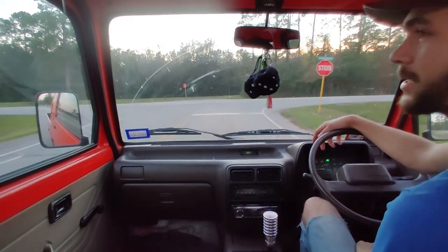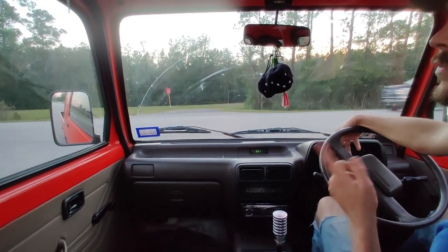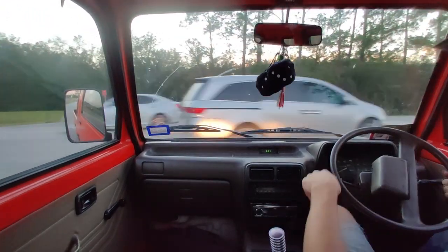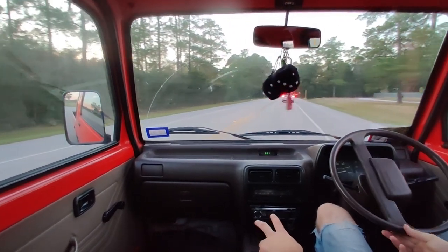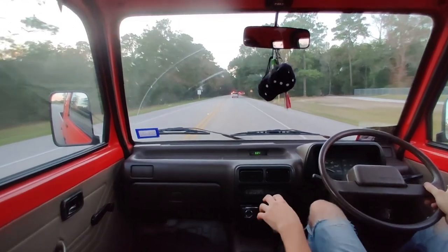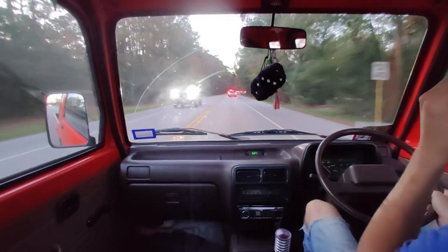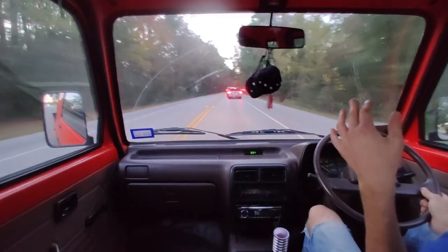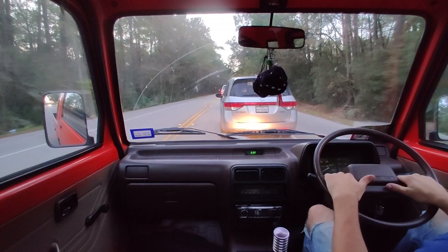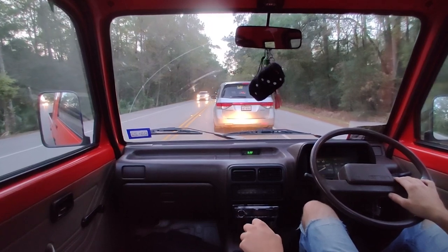Shout-out to Moto Cheese for giving me the idea to supercharge mine, because I'm going to do that. I'm also going to be swapping out the rear differential ratio for freeway gearing, because I drive on the freeway quite frequently and the gearing in this is incredibly low. I'm going in third and I'm only going about 35 kilometers an hour. They do sell the differential out of the Atrai vans and some of the turbo Atrai vans that have a lower ratio, so hopefully I'll be able to get that in there at some point.